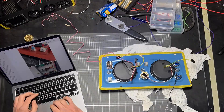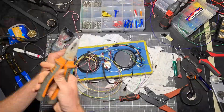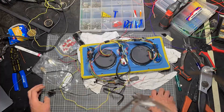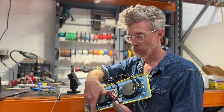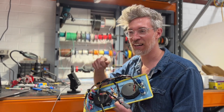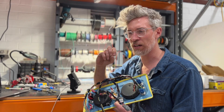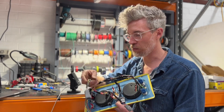On the back — and I'll cut to the time-lapse of me building this — I just wanted to show you it before we tape it all up and you lose all these colours. Essentially these three plugs connect to the loom: one for all the switches and buttons, one for the gauges with signal and lighting, and one for the ignition. We basically use DTM connectors for everything as much as we can. Really nice to work with human hands, as opposed to a dedicated crimping machine — very consistent crimping ability and minimal wastage.